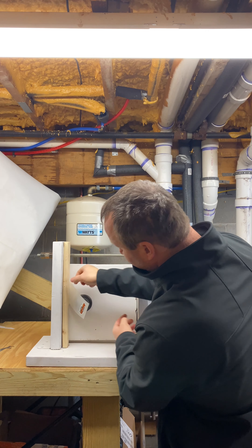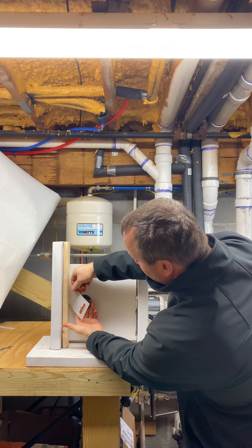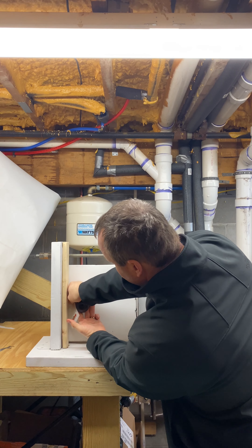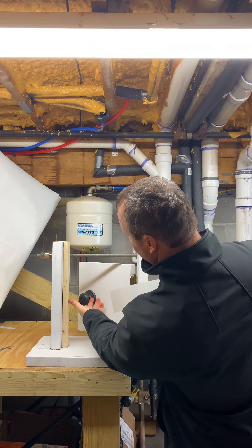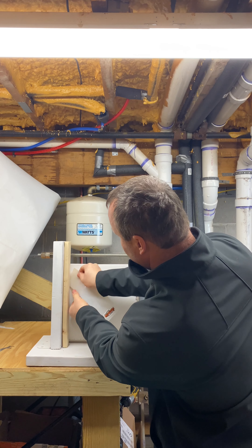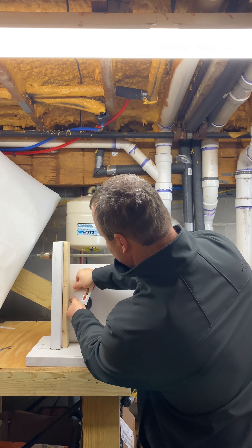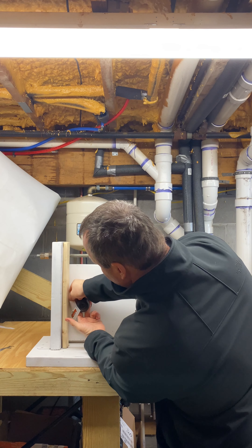Go on a 45-degree angle. Now you see this is locked. Pull the door towards you and then just push the swipe tool right through the lock, and the door opens right up. Once again: pull the door towards you, insert the swipe tool right above it, go down on an angle, pull the door towards you, and push it through.